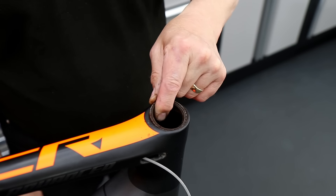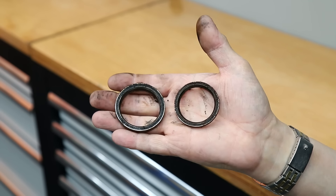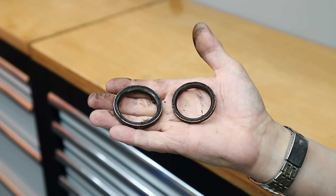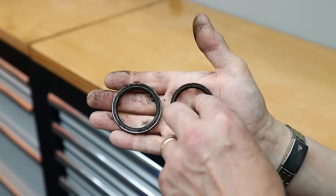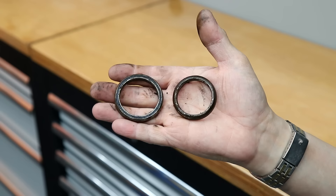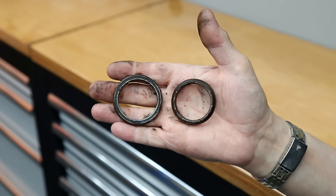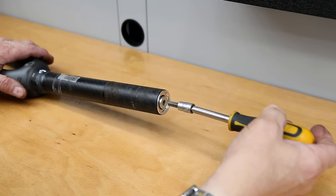Out come the bearings. You can already see there's a little bit of corrosion in the cups, and on the bearings quite a bit of corrosion around the top edges — they've started to go rusty. The ball bearings inside the races have started to rust, and that rust is seeping out of the seals around the actual cups themselves. They are life extinct, so we'll remove those and get new ones in there.